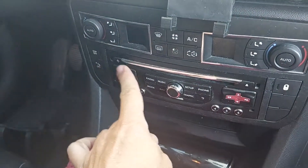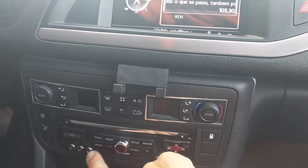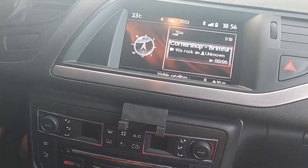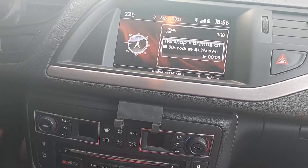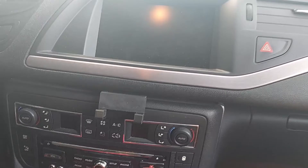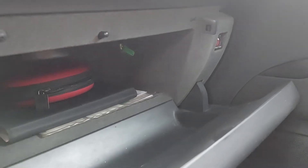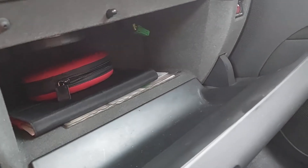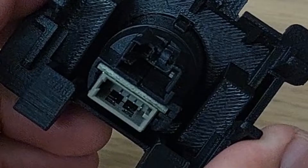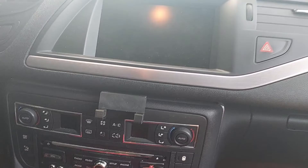Let's see if it works. Yep, that works. I'm happy with that. Before I end the video I should point out that even though the USB was working, the AUX was not. Why is that? That green plug that was dangling from the ceiling of the glove box was a five or six pin plug, whereas in the back of that black socket there were only three pins. So something was off. I have no idea what — I'll have to investigate and see if I can actually remedy this.